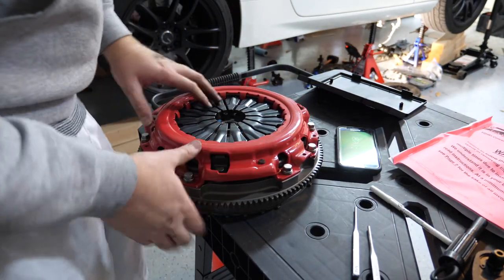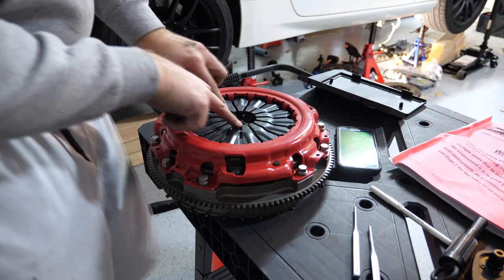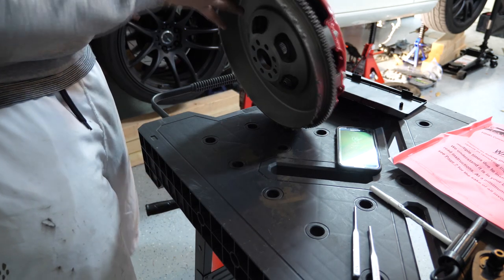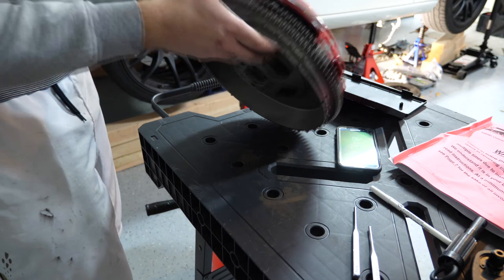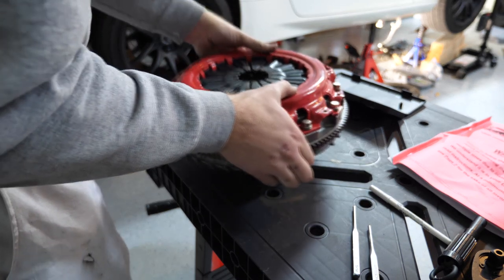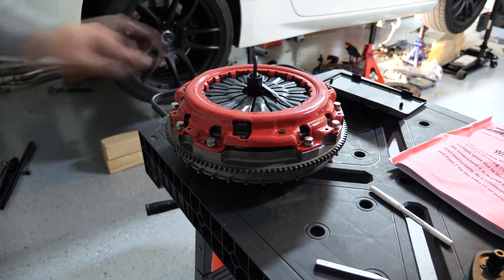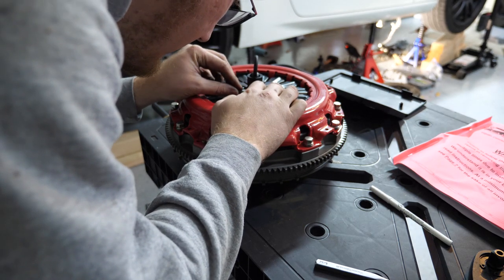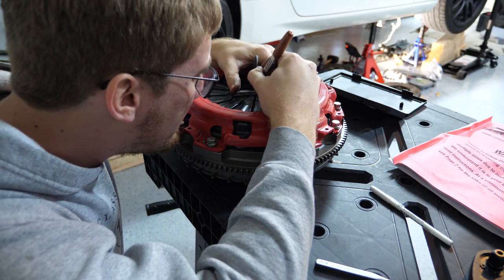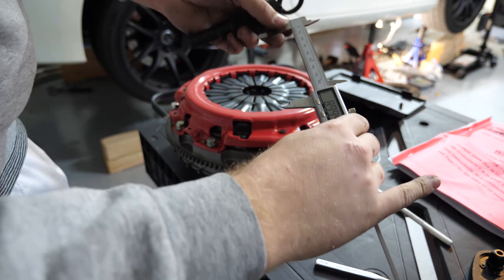Now what we need to do is take the stack height measurement. That measurement is going to be the distance between the back of the flywheel that actually mates with the engine and where these fingers sit — where the throwout bearing is actually going to be making contact. I used a wooden block as a hard flat surface to rest the flywheel on top of. For the measuring stick I ended up using the alignment tool that came with the clutch — sticking it all the way in so it rests against the wooden block. I then used a rod across the fingers on the pressure plate and made a mark with a sharpie to get a measurement of that height, then used vernier calipers to make the measurement and subtracted the height of the rod so it didn't obscure the stack height results.